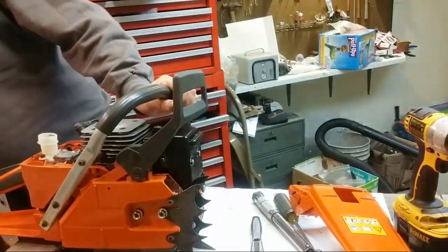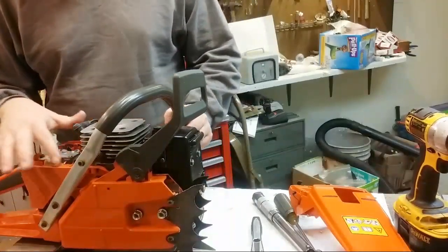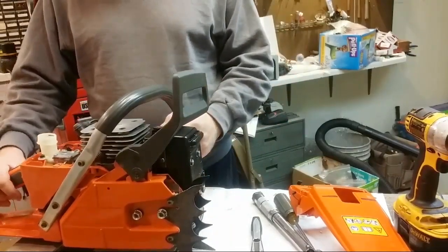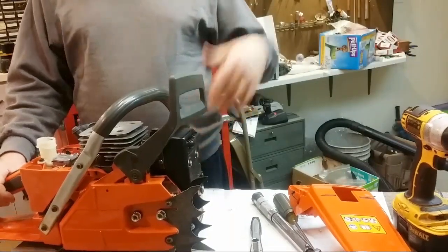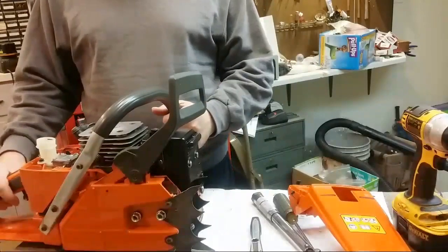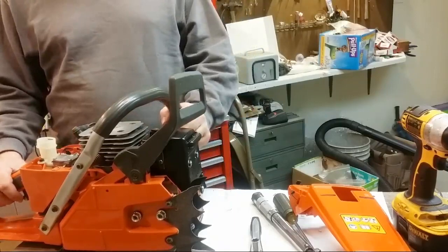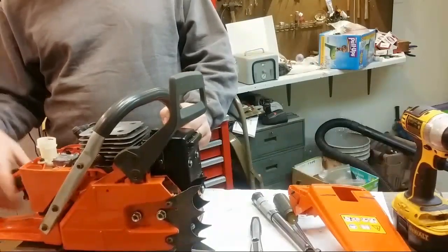Thanks, Edwin. So yeah, Brandon, if you want the 660 kit, there's nothing wrong with wanting it, but I spent a lot of money on mine. I'm probably north of $500. Ideally you change out the starter, the handle, the clutch drums come out of round sometimes. The clutches themselves are not the best. Wrist pin bearing, maybe a Meteor piston, or maybe an upgraded cylinder head kit.